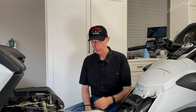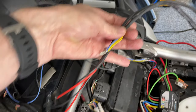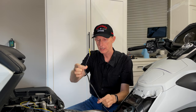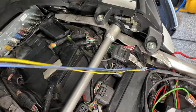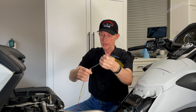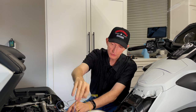What I did yesterday is extend all of the wires that came from the left side of the bike. You can see they're very long — plenty long to reach over to this junction box on the right side. These are the accessory wires, which I also extended, and I've gone ahead and shrink wrapped them. These two will get bundled together and zip tied to the frame on the left side. I also extended the wires coming from the rear of the left side of the bike — primarily my ShowChrome saddlebag lights on the left saddlebag — and I'm getting ready to put some shrink tubing on them to protect them. Those are also going to run into the junction box.